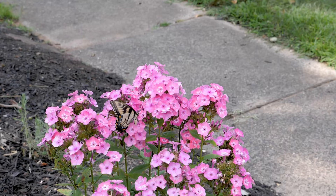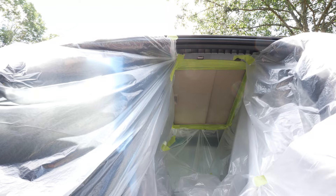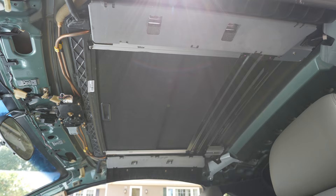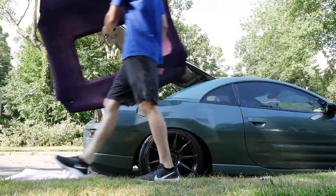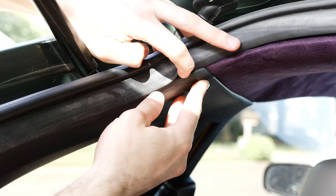In the meantime, we can tackle the sunshade that's in the sunroof. Unfortunately, these can't be removed without damaging them without dropping the entire sunroof. I was confident enough to do this; however, it wasn't worth the effort just to change the color, especially while having a perfectly functioning sunroof as it sits. Instead, a lot of masking and some color coat did the trick perfectly fine. And finally, it's time for the reassembly — it's essentially everything in reverse order, just far more careful and meticulous. You obviously don't want to damage your work. Tuck the edges back into the weatherstripping, lead your wires through the openings, and fix everything back into place.